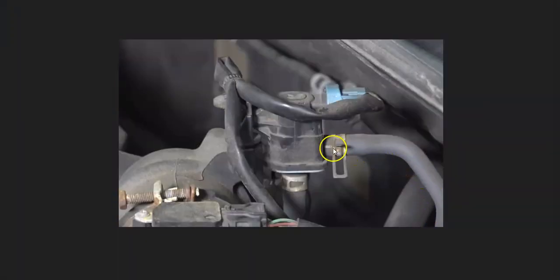If you follow the hoses coming up from the firewall, you'll usually be able to spot it, because there'll always be a hose going back underneath the vehicle that goes to a charcoal canister right next to the gas tank. That's what it's doing — taking the vapors from the gas tank and feeding them back into the engine. So there'll always be a hose going back underneath the vehicle towards the back where the gas tank is located.